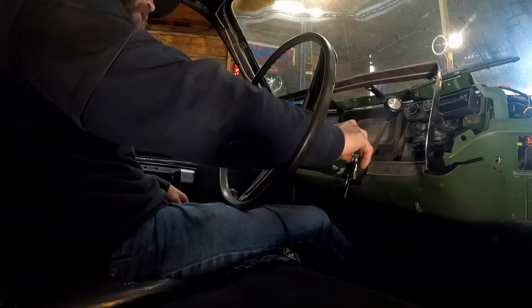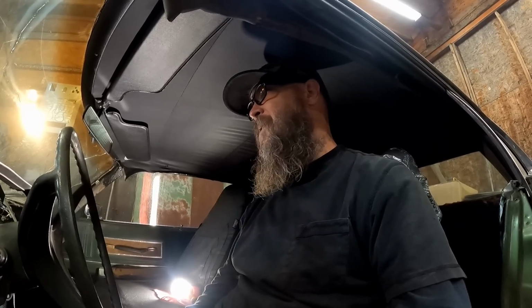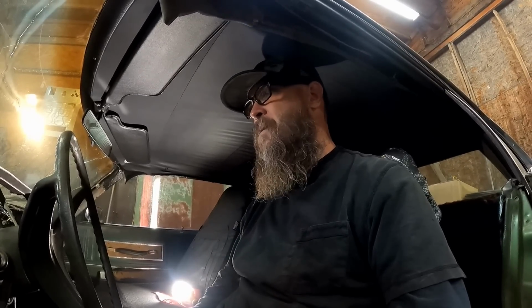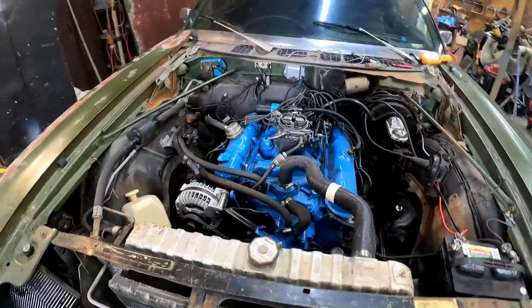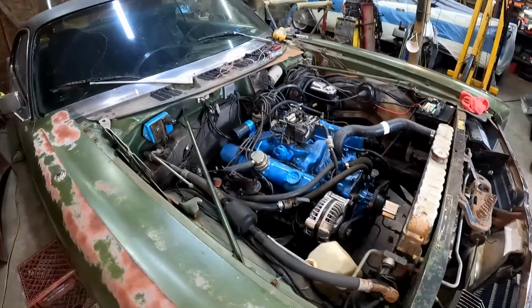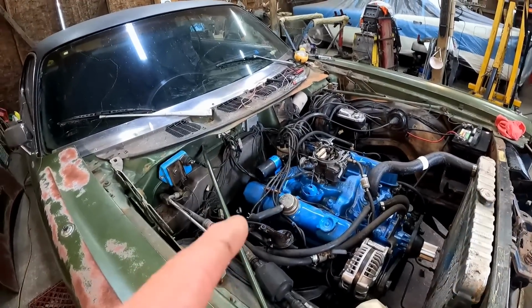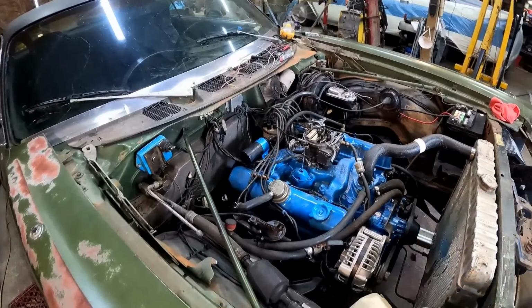Nah, it would have kicked off by now. Man, that's weird. I'm surprised that's not the issue, to be honest. I tested on it and I could not get anything to spark out of that whatsoever, so I assumed that it was probably bad, so I guess that leaves us with that old ignition module. That's alright, I ain't even mad at it, man. Without pulling that distributor out and messing around, we would have never found out that vacuum advance was no good.